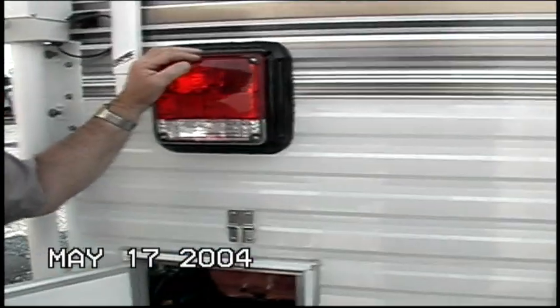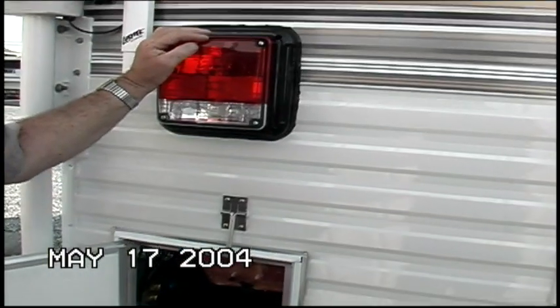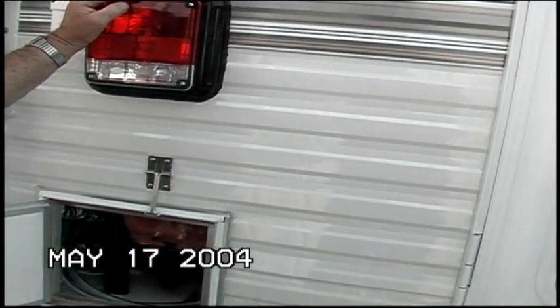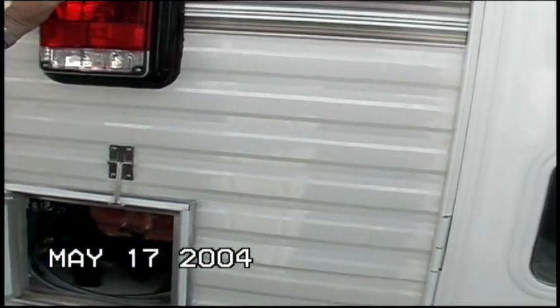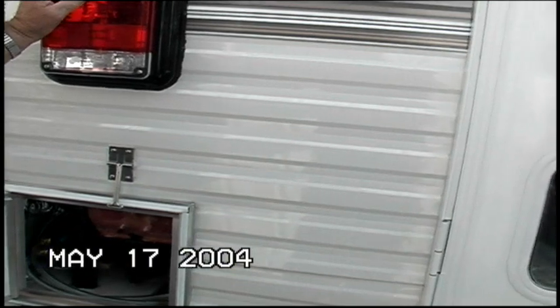How would you get 15 gallons in there? You just have to run it? No, just pull that little valve up and let it run for a while. It just opens up. Gotcha. Watch your little gauge and see how much you've got in there. Yeah, cool. What if you're camping and you don't have two-thirds of a tank of water? Just fill it up with some more water. Gotcha. But you have to have water in there to push the solids through. Right. If the solids don't go through, it's going to kick up in there, and then you'll have a problem. Then you'll have to pull the tank off. That's a pain, I bet. Yeah, it is.